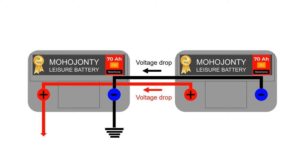The fleet of mind amongst you will be wondering about the other side of the battery equation, which is charging. We've got the same problem here but in reverse. When the batteries are being charged, the left hand will get the full 14 volts while the right hand will only get 13 volts. So we have the unsatisfactory situation where the left hand is doing more work than the right hand, and the right hand isn't getting charged properly.